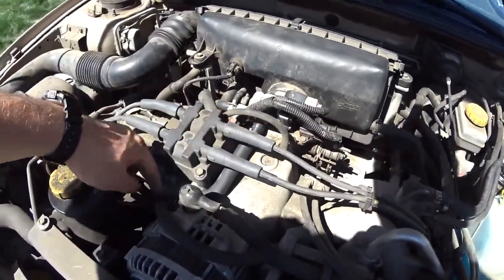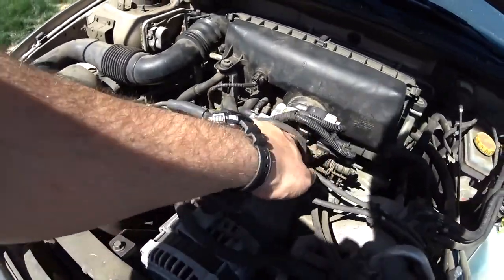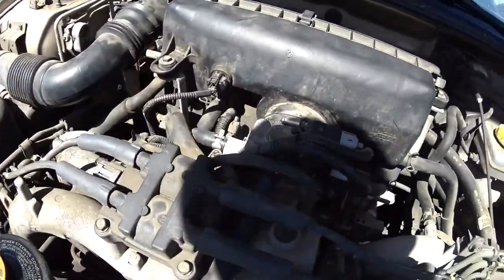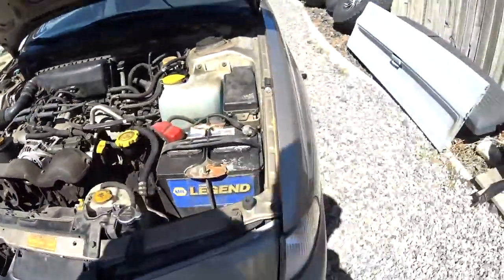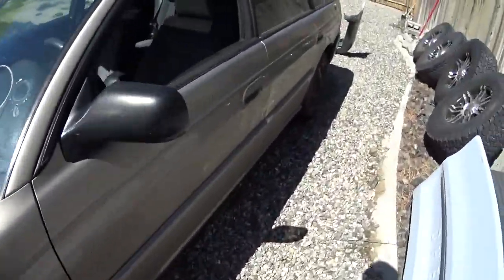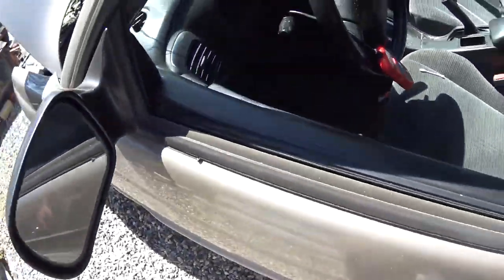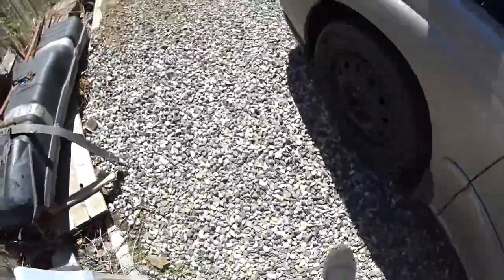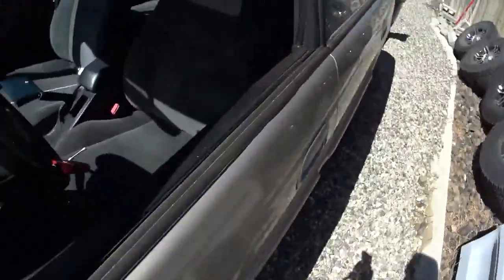And then the vacuum hose that goes there, I actually noticed it had a small crack over here, so I just put some tape on to see if it'll fix it, and then a clamp on the bottom, and it seemed like it fixed it. The car idles good, no issues idling or anything like that anymore. I was gonna show you, just gotta find the piece. There. By the way, Optima came through again, took a day to charge the battery. Charged it, holds charge, starts great.